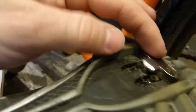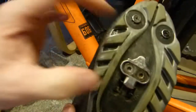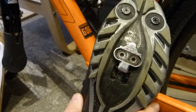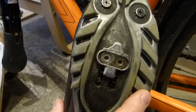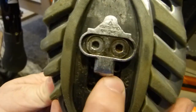I'm not overly concerned with that, because this amount of corrosion does not significantly chew away the thickness of the metal that's needed for a secure condition. Of course, this is to be monitored for signs of corrosion, looseness, and wear as well. This is made of mild steel, and it originally came black powder coated, as it is listed in this manual here, that this is black. That's what that word refers to. But now it's bare, meaning all the powder coating is gone from it.